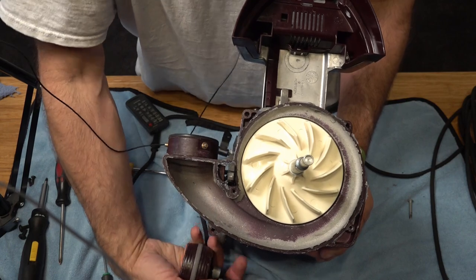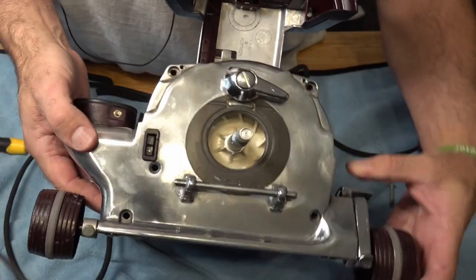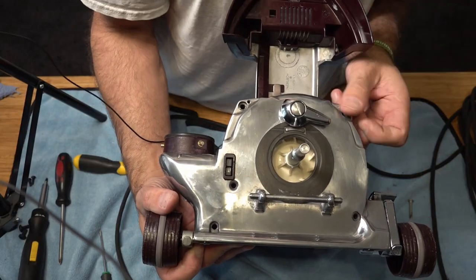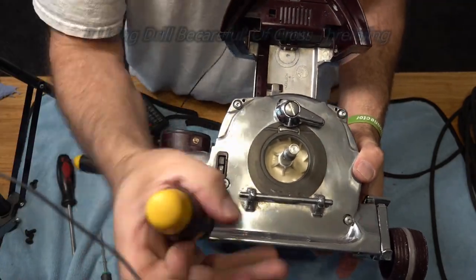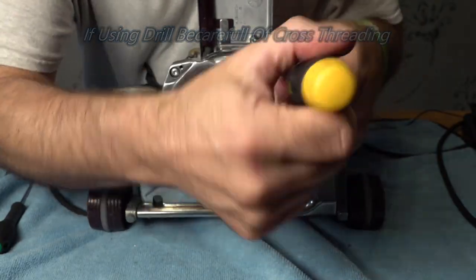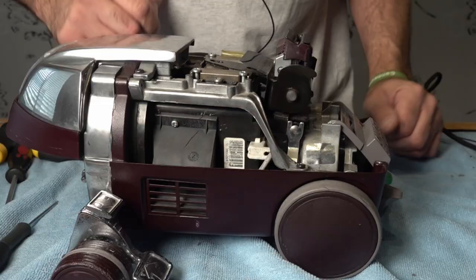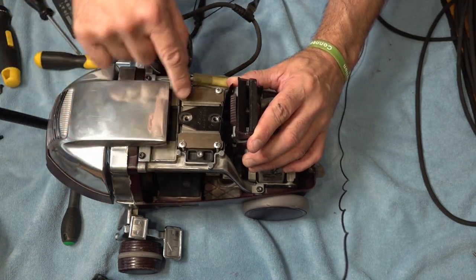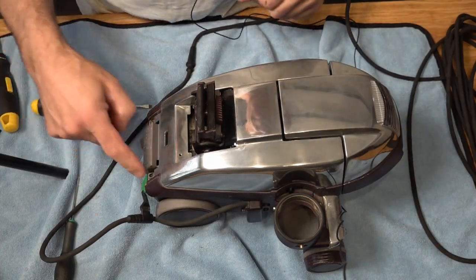This way is a little bit more awkward than when you've got it fully apart. Grab the front and slot it in there, push that down. Make sure everything is lined up and it's gone over the safety switch. Grab the two longest bolts and put those in the top, then the two shorter bolts in the bottom, and tighten those up. Now attach the handle yoke — if you've got a G3, G4, or G5, there's a little pin here that slots in and drops on. Make sure the handle yoke sits roughly in the center, then put the two screws back in. Drop on the top cover and replace all the screws in reverse.